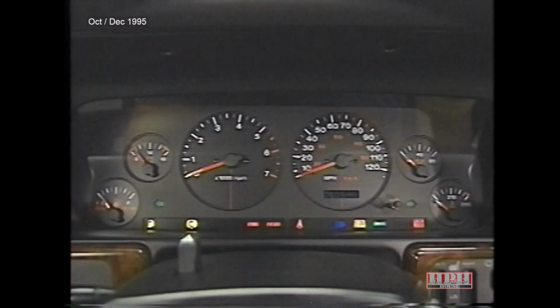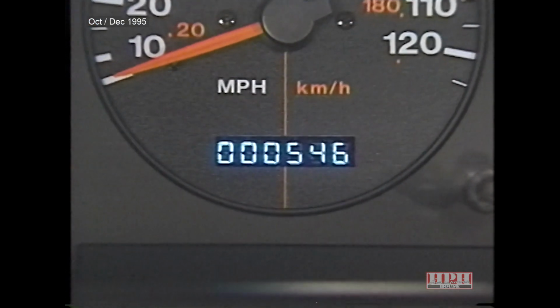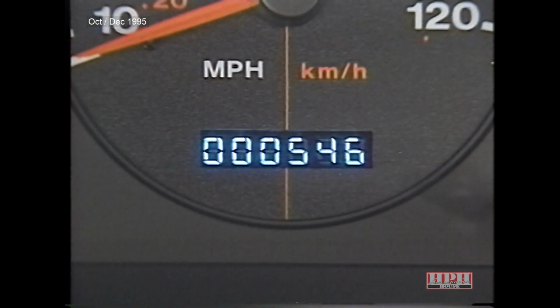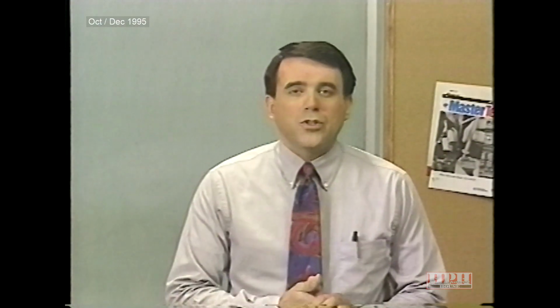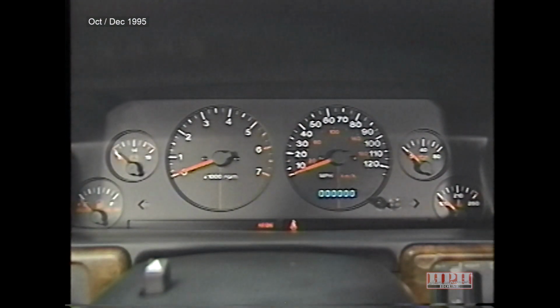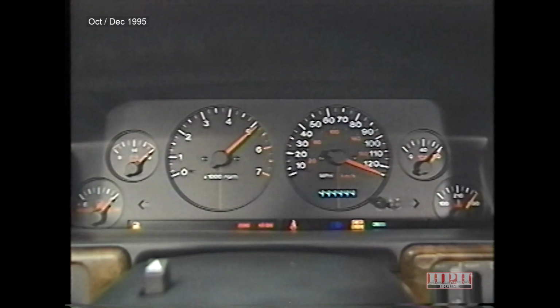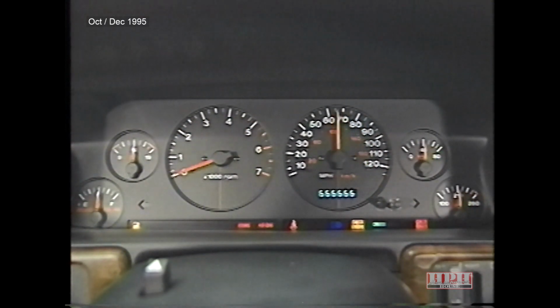The gauges in the mechanical instrument cluster, or MIC, appear the same as last year. Only a vacuum fluorescent display has replaced the mechanical odometer wheel in the speedometer gauge face. The MIC cluster will not generate diagnostic trouble codes, and gauge calibration is not adjustable. However, you can perform an actuator test using the DRB3 scan tool. The test positions all the gauges at their calibration points, lights all C²D bus controlled lamps, and forces the vacuum fluorescent display to count from 0 to 9.